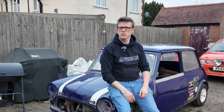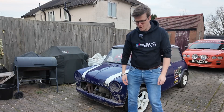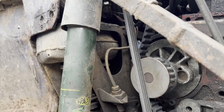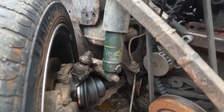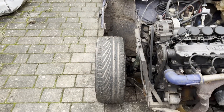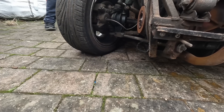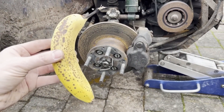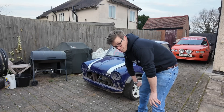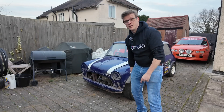So what's wrong with it? Why are we doing this project? Well, there's a few things that aren't quite right. The springs are still rubber doughnuts made for the A-Series engine, so they're the wrong spring rate. To get a good low ride height with big wheels, the top arm angle is wrong, so it pushes the doughnuts across rather than compressing it. The roll centre is completely wrong — far too low — so I get lots of body roll. To get enough Ackermann to spin the cone, I have to have massive toe out. With the wheel spacers, the scrub radius is huge, which gives lots of torque steer. The brakes are weak and don't have any assistance, so I'm not strong enough to lock the front wheel, so I smash up reverse gear when I change. So that's a long list, and that is just the suspension and the brakes. There's more.